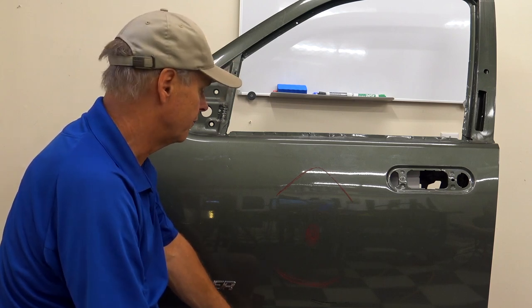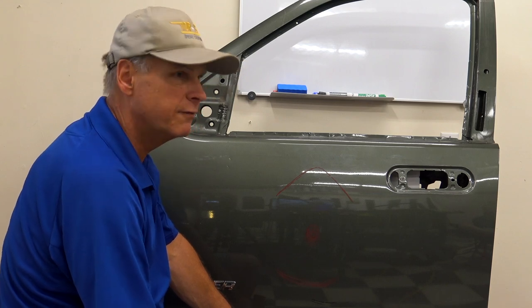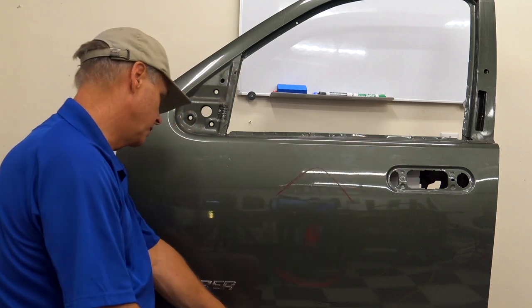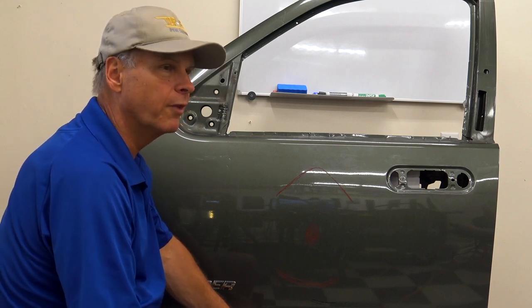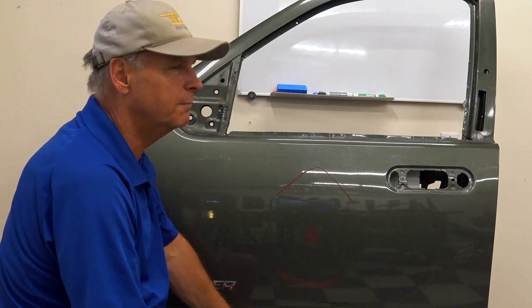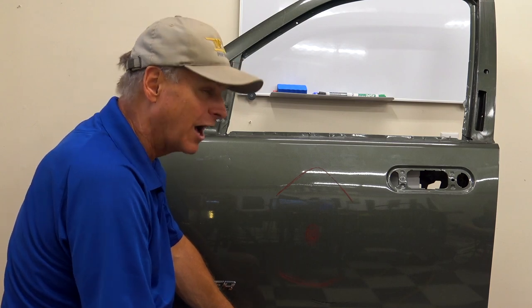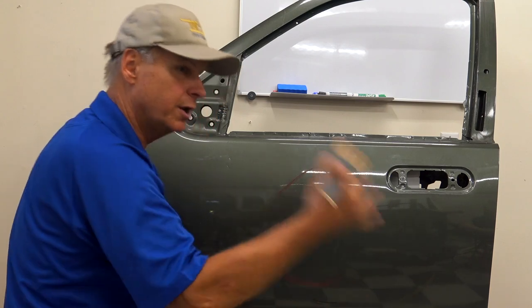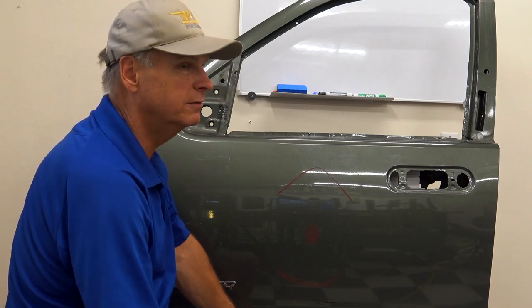That's just pretty much a matter of what did you promise the customer? What percentage did you promise? If you promise them 95%, put the board a few feet back, make it look good, you're done. 98%, put it back a few feet more than that. 10 feet is usually for a little bit more than 98. And like I said before, guys, a true 100% large dent repair, I mean a real large dent repair, I've never seen one yet. That includes me.